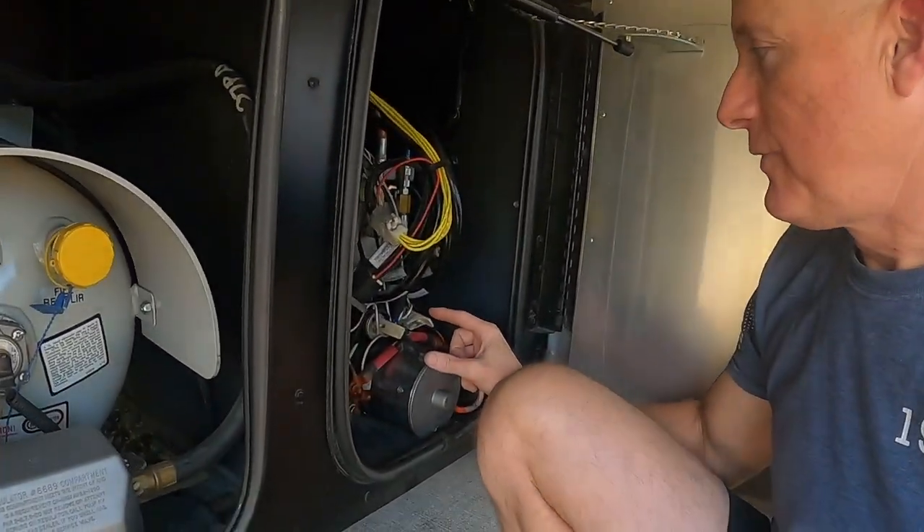What you don't want to do is fire your rig up or hit your hydraulics while you have that out. After I got the new hydraulic cylinder back in and got everything bolted up, I came over and flipped the switch back up, and that allowed it to operate. We bumped it out a little bit and then started it back in, going all the way in. That is supposed to take any air that's in the line out — so you don't have to bleed the lines, which was great. If you had a lot of air in the system you'd have to bleed the lines, but luckily just a little bit of air and it'll take care of itself. We brought it all in per Tiffin's instructions, took it out about six inches, brought it back in, held it for about three seconds, took it back out — did that about three times until everything seemed to work great.